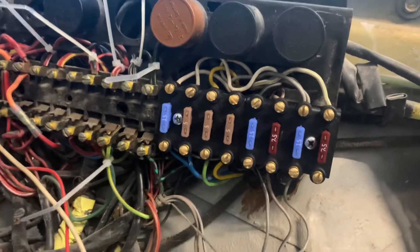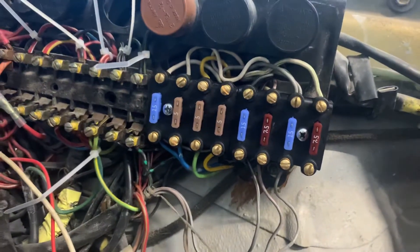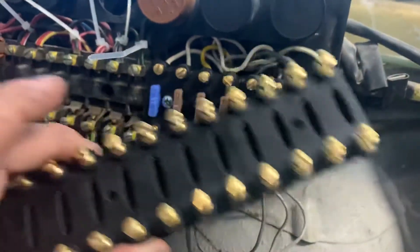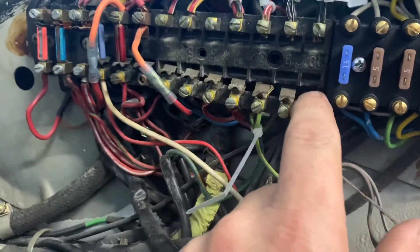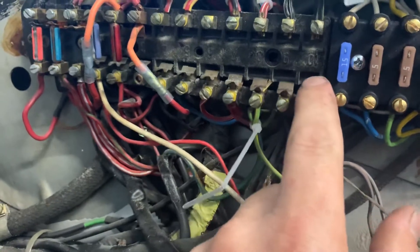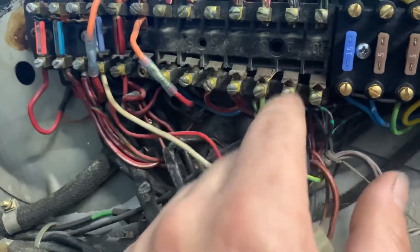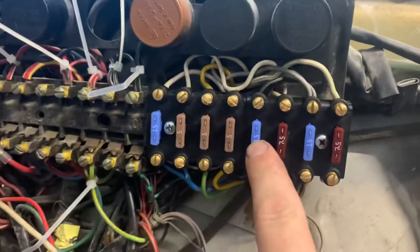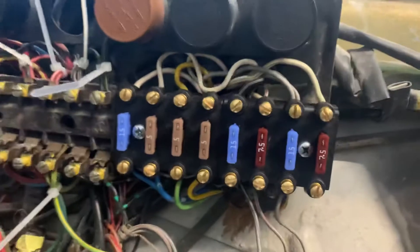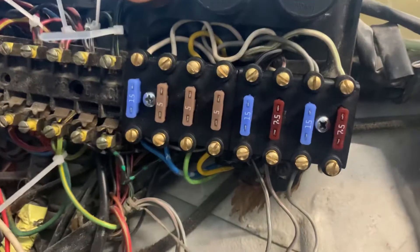Welcome to Brightworks. We are installing what's called the ReFUZE panel from CDD Auto Gear. What happens on these old fuse panels is the bakelite will break, and when that happens you're not going to get any tension, so all your fuses fall out or don't make good connections. So we're replacing them with this ReFUZE product — we've done a lot of these and I like them.